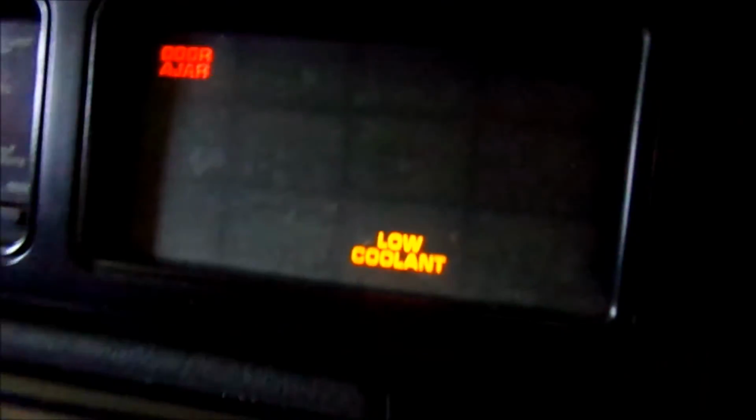And next, and we'll save this for the next video, I'm going to pull out the climate control and see if I can get it to, you can't see that, but the lights are blinking back and forth there. It's like a ground issue or something, maybe inside. Take it apart, inspect it, and try and clean it and see if I can get it to ground to the case. But now I'm going to try and bleed the system out a little better and get any bubbles or anything out of it. But even at 158 degrees where we're at now, I'm getting good hot heat, so I'm happy about that. At least I can use it if it gets cold.